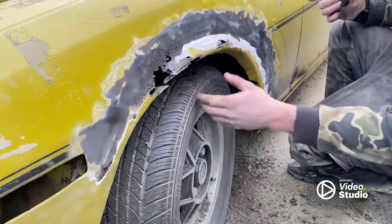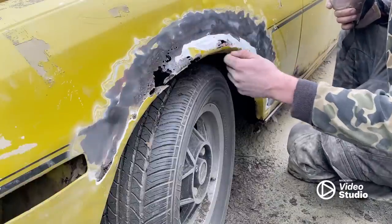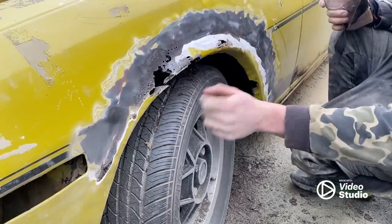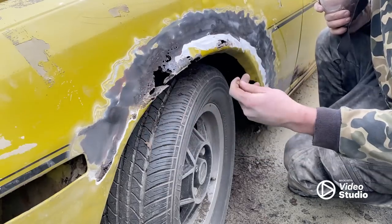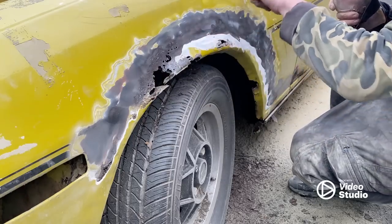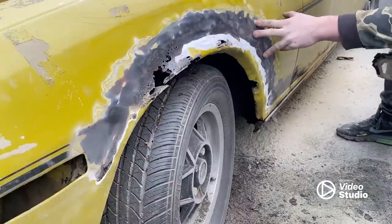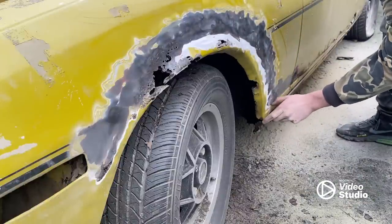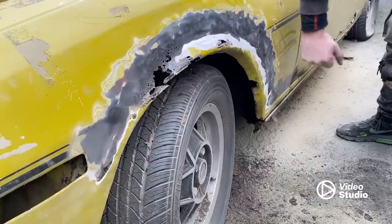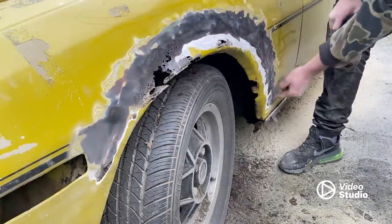Right, so first panel done. I know there's a lot of holes but I'm actually really happy about this — it's way better than expected. I think this car might have had a little knock on this front corner, maybe just a car park bump, and then someone skimmed a little filler over it which has failed. When filler fails it swells up and allows the metal underneath to rot. But the repair panels come right up here and the metal's solid way down, so it's looking pretty good. I expected fiberglass and all sorts, but yeah, it's not bad at all.